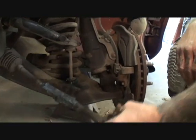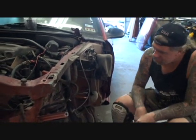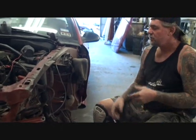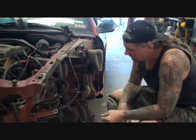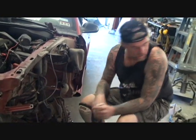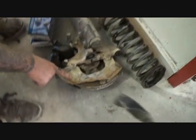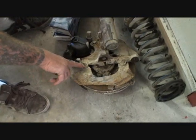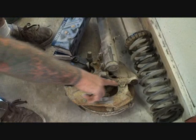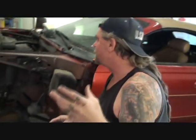You can see that right there — what a pain. So let me go ahead and remove all of these parts here, basically the same thing you just saw. We'll get everything taken off and then come back and look at the damage on our vehicle. I did notice, if you look at this, you can see where this has been dragged around in the junkyard. We'll have to take that apart and fix that. I noticed these are pop-riveted on — it's got the Big Daddy quarter-inch pop rivets holding this on. So that's going to be a challenge.